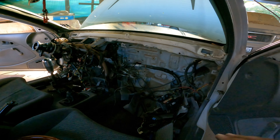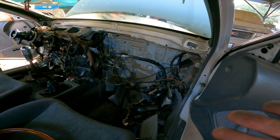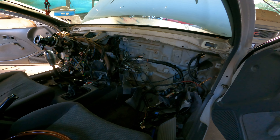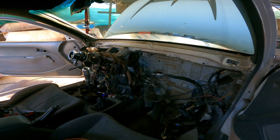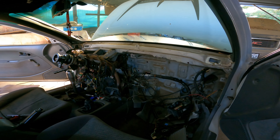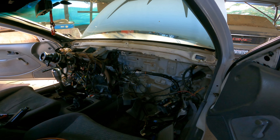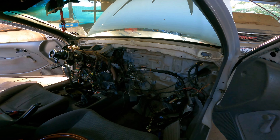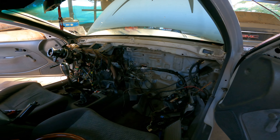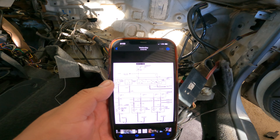The dash is out. Thought I was done with the install - totally not. I think I screwed up by cutting this side off, but I don't know of any other way to have gotten it done. Dash is out. Gonna hook up the cluster and just try to follow wires and see if I can find where I messed up. Fuse box is on, battery's connected, everything. I get no lights. Everything else works - the car will start and everything - but no lights. So that's not good.